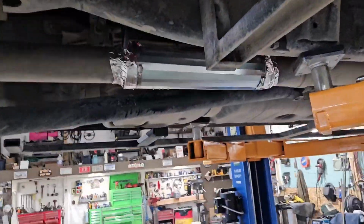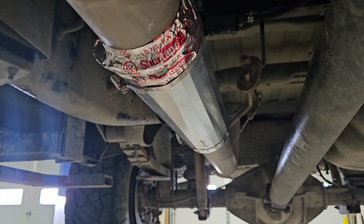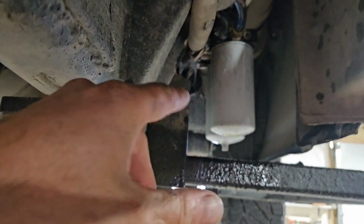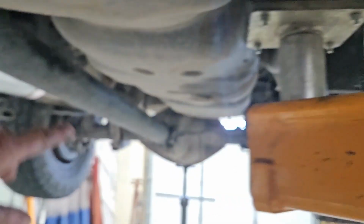All right, it's a little challenging. I had to take the funnel, took an old chunk of garden hose, connected to the fitting, put the funnel up on top of the box for a high point, and filled the system. It took a little while for it to siphon through the coil. Plus you don't want any air in it because like a boiler in a house, if you have an air bubble in there, the water won't flow. So I had to come over here, take the fitting off of this. I actually took my brake bleeding tool, which I currently broke. So Harbor Freight, here I come for another one. Took that off so I could pump and cycle through till I had flow out of both sides, and then hooked it up, pressurized it up there, filled it up there with just gravity pressure and had good flow.